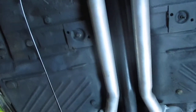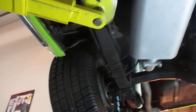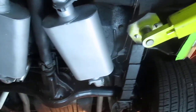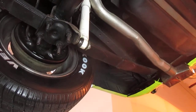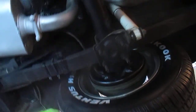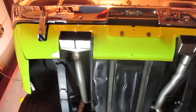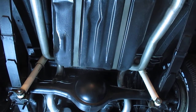The back pans are in really good shape. All of the lines are not showing any rust. The exhaust appears to be fairly fresh and new. This rear pan over here is also in great shape. Where the sub-frames come back, there's no rust in any of the corners or any of the parts. There are plugs right here that still appear to be all original to the undercarriage of the car. It does have an 8 and 3/4 inch rear end. The chrome back here is also in great shape, and the gas tank and the straps are beautiful.